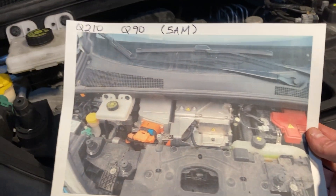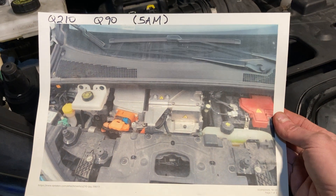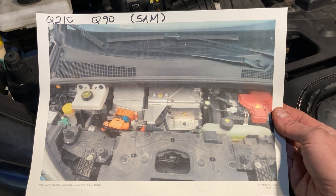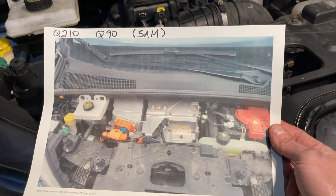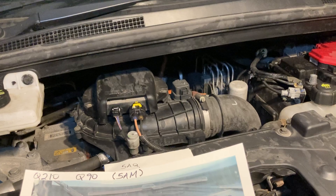This is very high-tech, I'm sure they'll appreciate. The first Zoe that came out in 2013 — under the bonnet — looked like this. You've got that metal box on top. From 2015, there was a different motor type available, and it looks like this one, with the round plastic fan housing. That's a motor cooling fan.